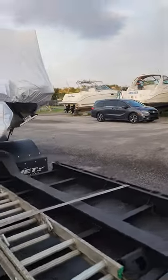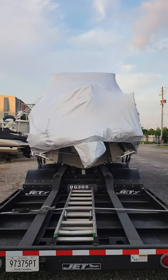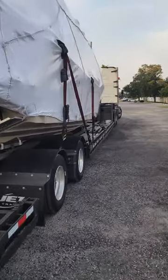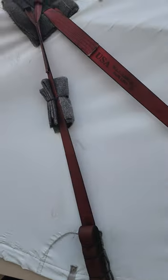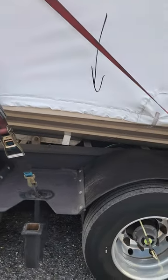I'm all the way across the US and the boat is still sitting level - not tilted to one side or the other - because I put those extra straps going down. Both sides are strapped identically. From this cleat, one strap helps pull it forward, and another strap with a slight angle runs more or less straight down to the D-rings.